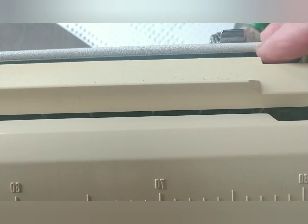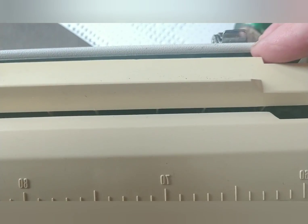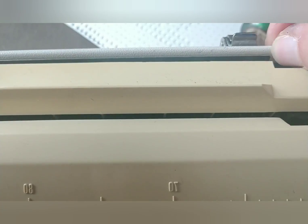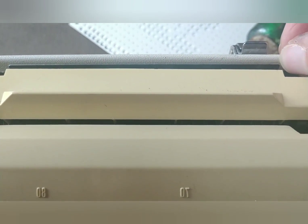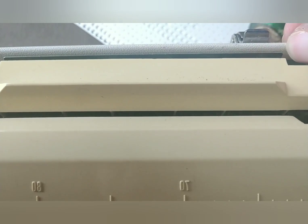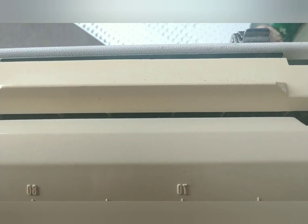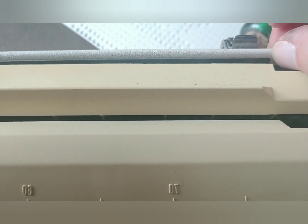It's a plate sticking up and visible if you look down just inside the case where I'm poking. In my case, that had somehow slid behind the lip of the case. So what was happening was the card was bumping right into the case, not protected by the card guide. We had to reorganize that, and now everything is just fine. Don't know how it can slip back there, but it did. With that in mind, if you can see that plate and you're having reader troubles, probably this is not your problem. But if you can't, if all you see is the lip of the case, it's definitely worth looking into.